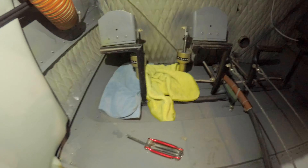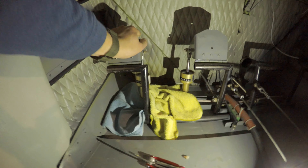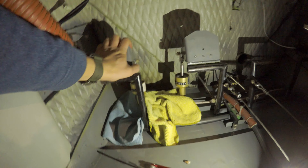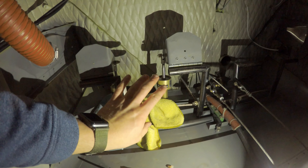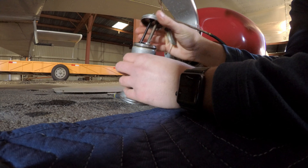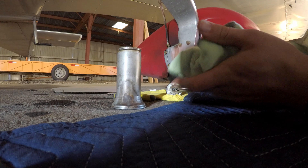After a couple pumps, I came down and checked the pedal feel — it's solid now, which is promising. None of it has overspilled the top yet. I don't want to risk it being underfilled, so I'm just going to overfill it and then drain a little bit out so I'm sure of the level. I'm going to tighten up all the fittings and top off this side too, to make sure we're 100% with the entire brake system. The pump canister is still fairly full, so I'm going to take this opportunity to top this off as well.